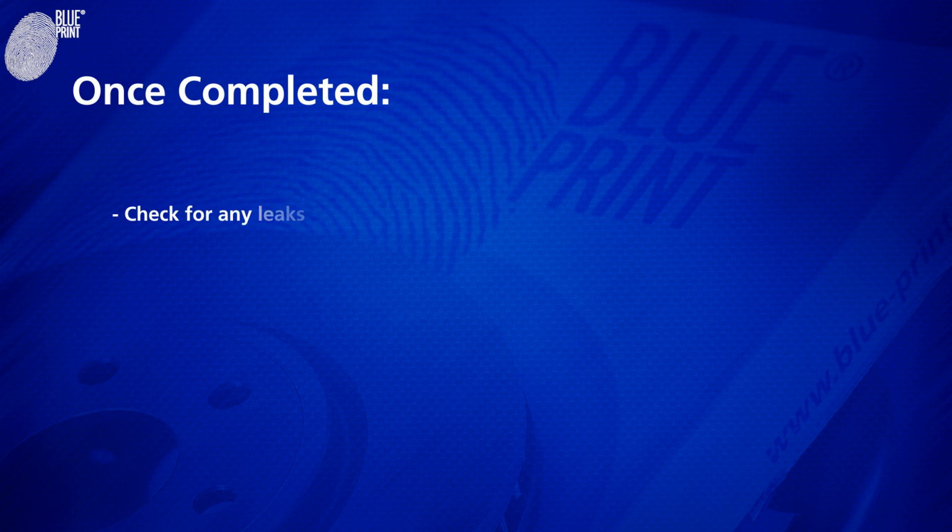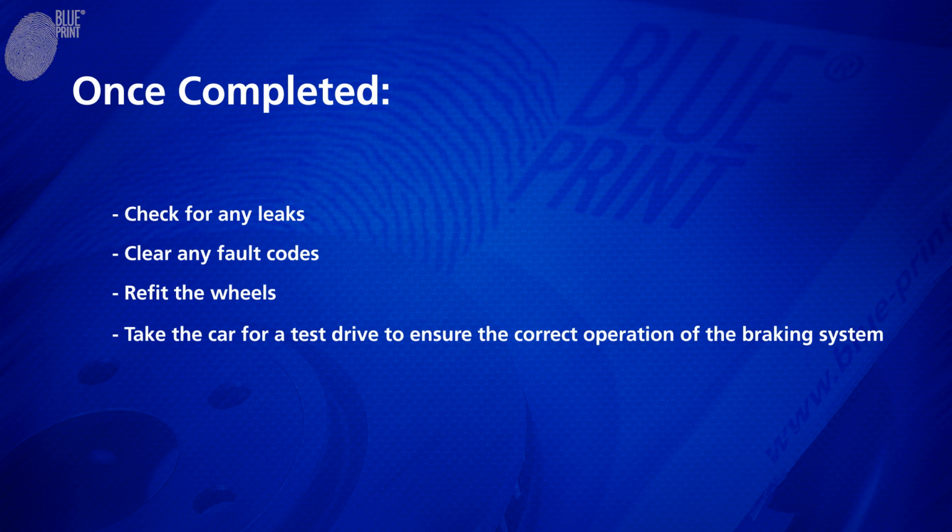Once completed, check for any leaks. Clear any fault codes. Refit the wheels. And take the car for a test drive to ensure the correct operation of the braking system.